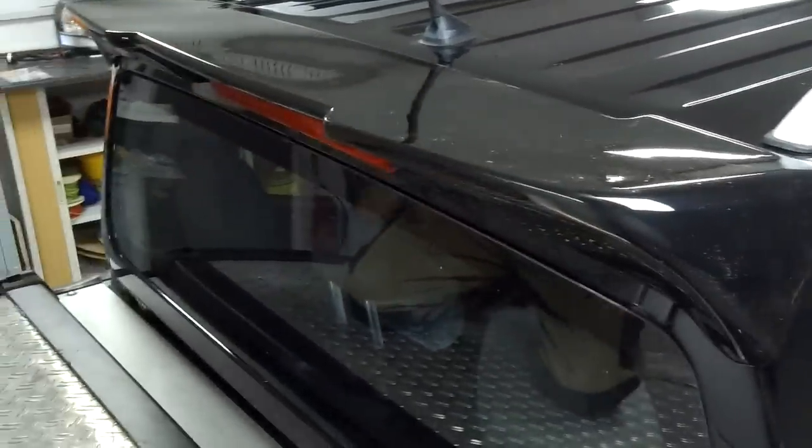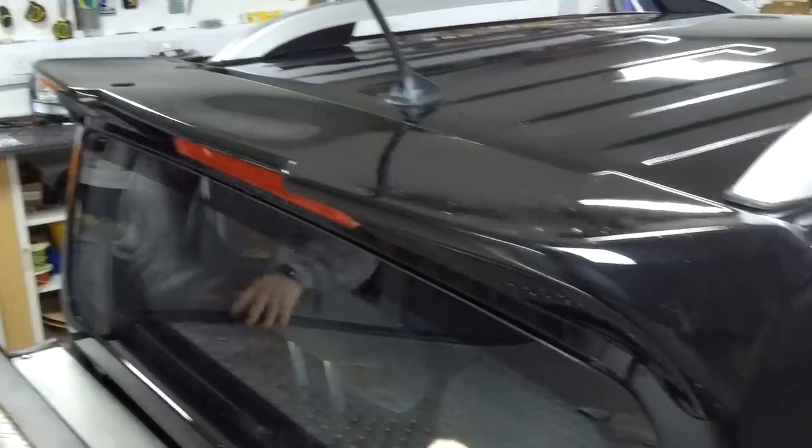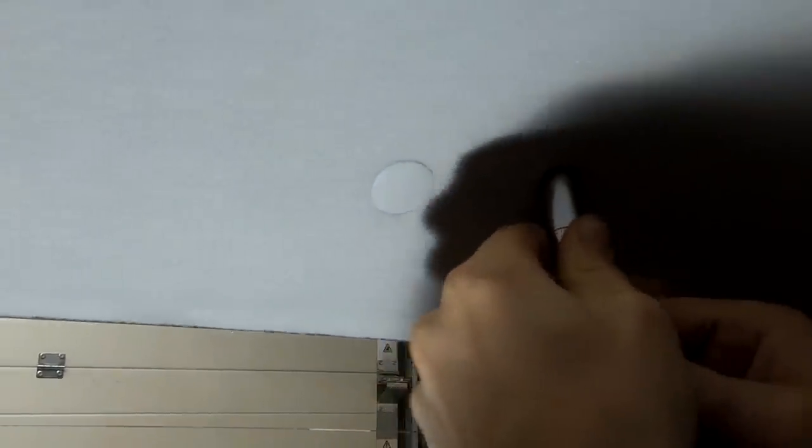Right, so that's all that on. Now what we've got to do is put the bolts on the inside and put the caps in the headlining. So we'll get the two flange nuts and we'll come on the inside. We've got to try and find them. So you've got a long reach socket. The flange nuts stop it dropping down the socket. You go through there.